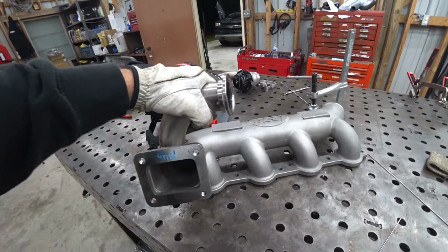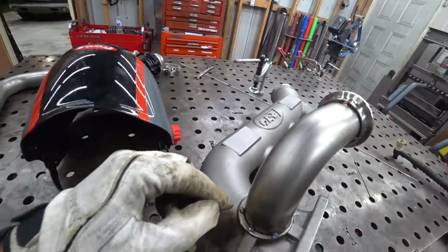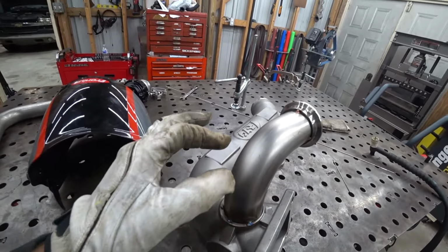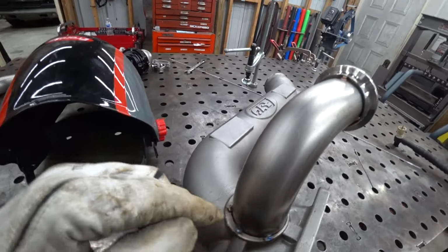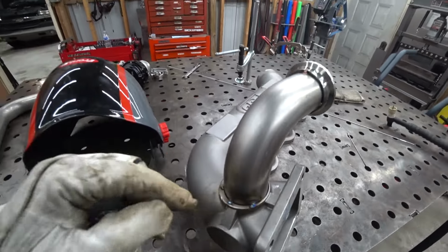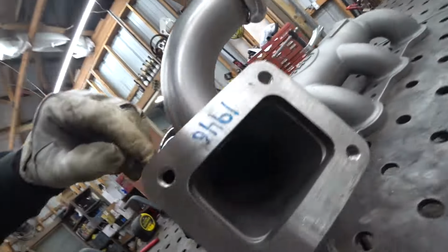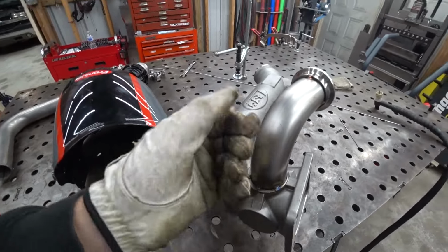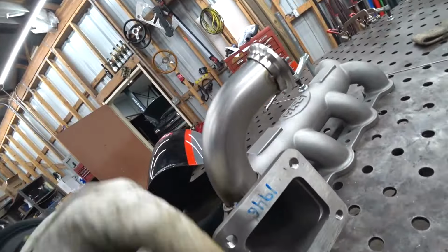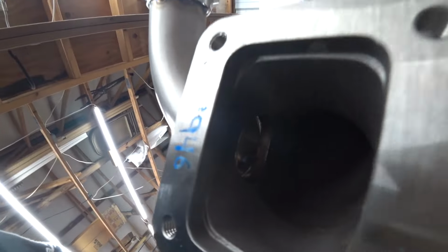All right, we've got our tube all tacked up. I basically did an inch and three quarters, which the hole saws always walk a little bit and they wallow out the hole. I did that for like a quarter inch, and then used an inch and 5/8. So that way the pipe could recess down in there a little bit for the weld, but it wasn't going to be that diameter all the way through. So you can kind of see it there.